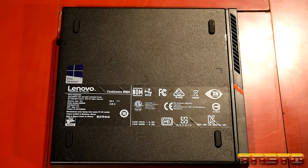But it has an Intel Core i7-4710HQ, base clock at 2.5 gigahertz, turbo 3.5, and the score on that is 5504. So we're going from 5504 to 7249, okay? The CPU in that is better than the current CPU that's in the unit, but the upgrade CPU is miles better. And that laptop does have 4 cores, 8 threads, just like the upgrade CPU.